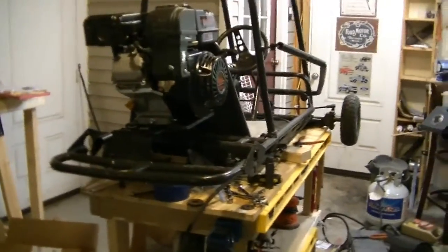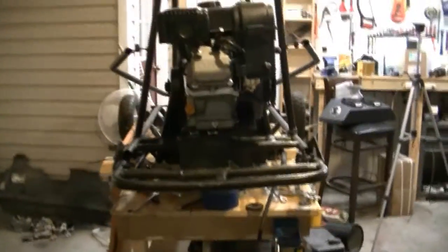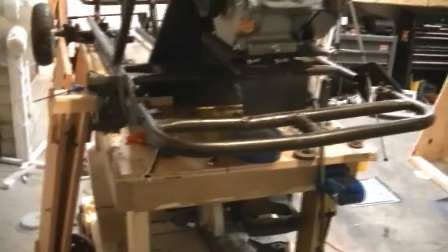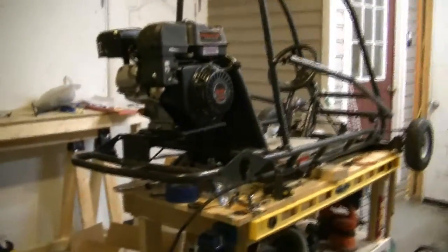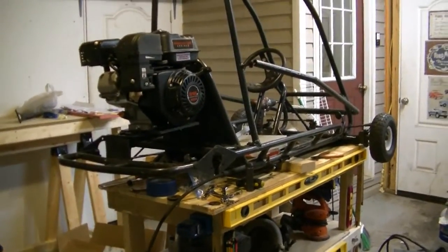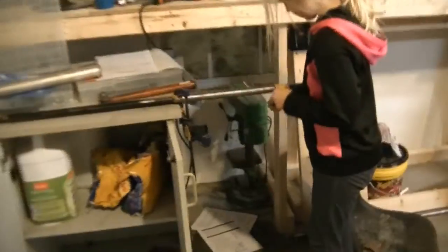We started with pulling the axle off of this go-kart. I had to pull the brake disc off and all the components on the axle so I can mount the axle, put the sprocket in — which will ride in between — and then put the brake rotor, caliper, and disc on last. It was already on the axle and I couldn't get it off. The key was stuck, and also someone had painted this go-kart with the axle on it, so a lot of the paint got on the axle and was locking it right up.